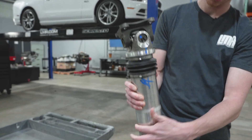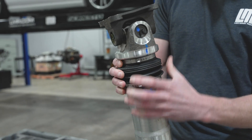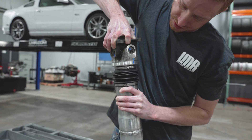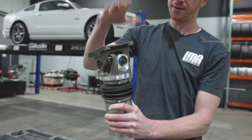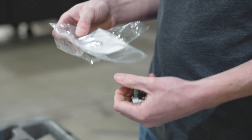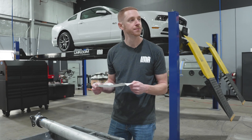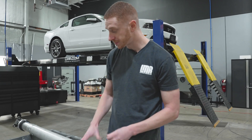You can see where they welded the end pieces together, and this allows it to articulate — pulls out and goes in — and that's for driveline sweep. Six bolts: Allen drive and two hex drive. We'll check the instructions and see what they recommend.